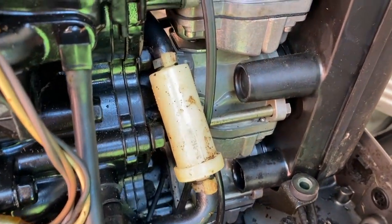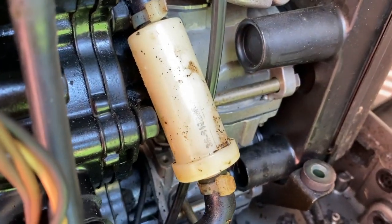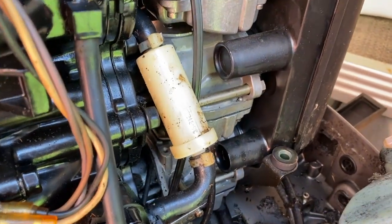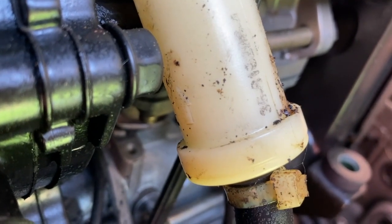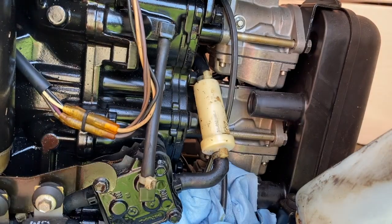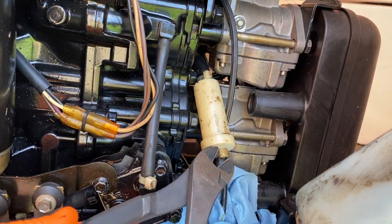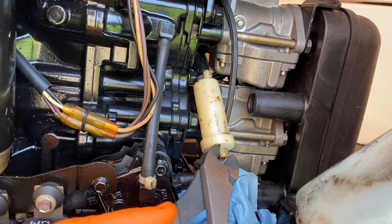On either side we have a hose and zip tie. We are going to carefully cut those zip ties away and remove the filter. There's the part number. Down below in the comments and description will be a link on where to purchase a brand new filter. Note that little arrow right there — that is extremely important when installing the brand new filter. We want the arrow pointing the same direction toward the engine. I've put some shop towel at the bottom portion of the lower cowl to catch any fuel that leaks out.